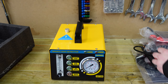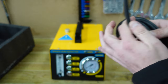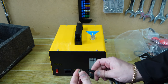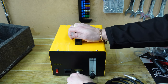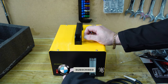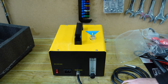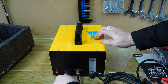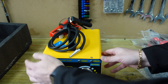We're going to go ahead and use this machine — I'm going to show you guys how to connect it all up. First, we're going to get this line right here, which is for the smoke itself. You'll see it's got a rubber cord on it. What you want to do is remove it, plug it straight through here, lock it onto here, then push the hose onto the grommet right there and lock it up. That's your airline secured on the actual machine. Now we're going to plug the power supply in, and then that's all we need to set the machine up before taking it over to the car.